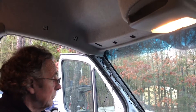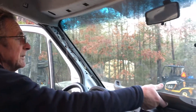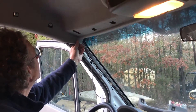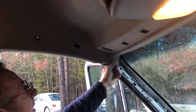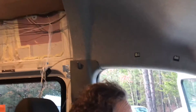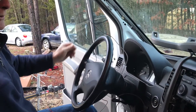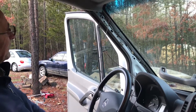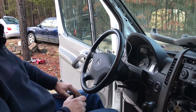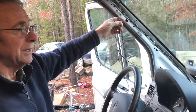What we had to do to get this wire through here for the backup camera was pull down the sun visor so we could get a little room going between the headliner and the roof of the van. We were able to fish the wire through, and I went ahead and fished an extra wire through to use as a fish wire, so when we need to put another wire in we'll have something to pull on. We keep a continuous wire going through here for fishing because this is a hard place to get a wire through.